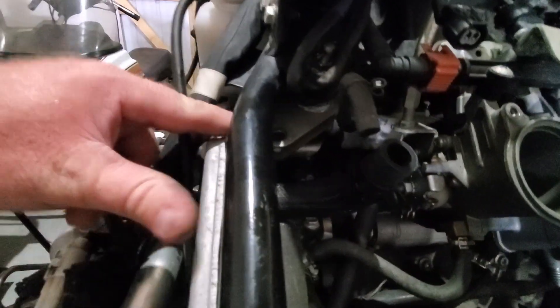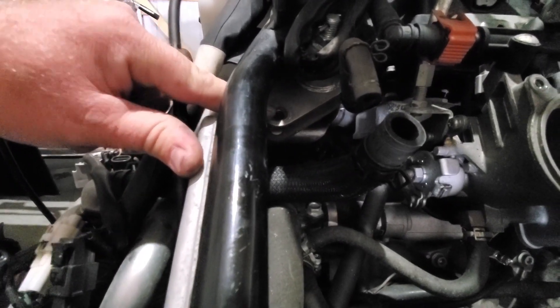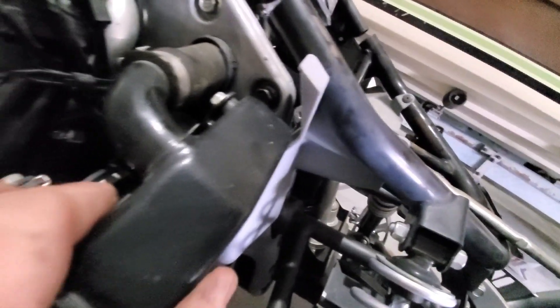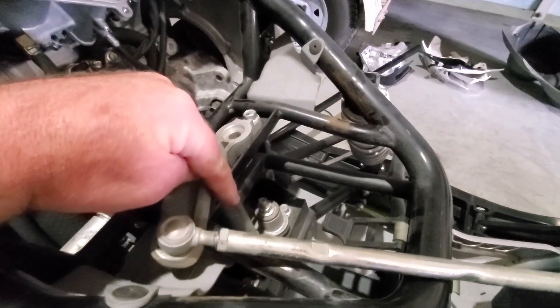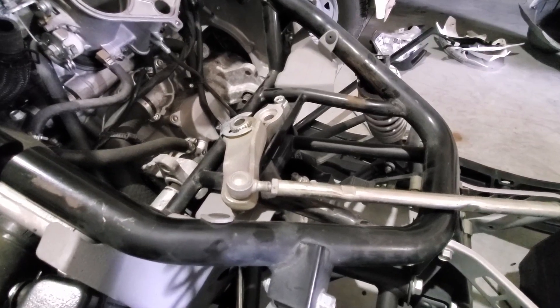Up here at the top, right underneath the coolant recovery tank, there is a bolt that needs to be removed, which connects to the steering linkage that I've already removed and pointed towards the front so it's out of the way. Then the top bolt and the bottom bolt back in here on the radiator need to be removed so the radiator can scoot over to the side to access this bolt. What we're going to do is take the entire front off of the sled, and that's going to allow us access to the bushings that are down in the back and also to see where the looseness is in the front end.